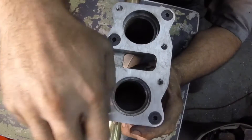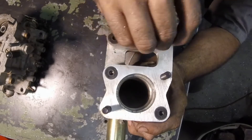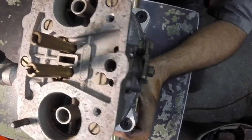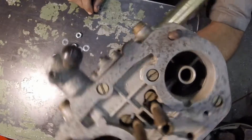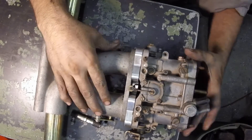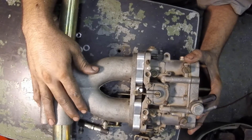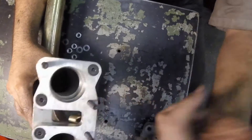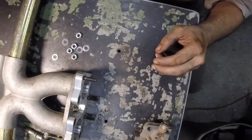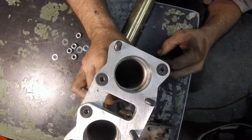No interference. And we put our studs in. Now we can spin the carburetor around and mount it backwards. On the manifolds like this where there's material connecting the two bores, you might have some slight interference on that accelerator linkage. Once you get the gaskets in there it's not going to be that bad, but a little die grinder or something could clearance that out. On this other type of manifold, there is no problem because there's no material to interfere. So that's it — an adapter plate for mounting a Weber carburetor backwards. Thanks for watching.